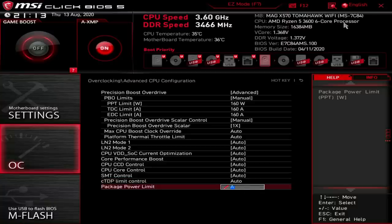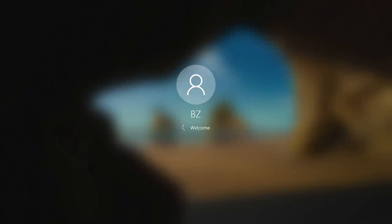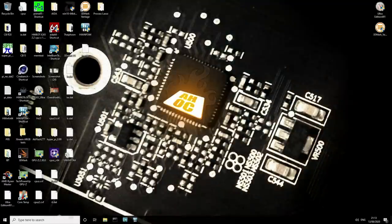What if I put these back to auto? This obnoxious AMD software. The thing is, the behavior is not even completely consistent across different motherboards. I think the most vanilla implementation of AMD BIOS is Gigabyte, and then MSI works, but they definitely have done some extra things to their BIOS. And then there's ASRock, where ASRock's BIOS has broken power limits a lot of the time.